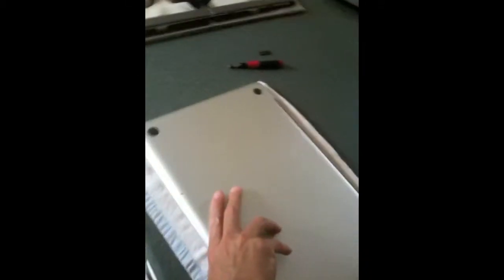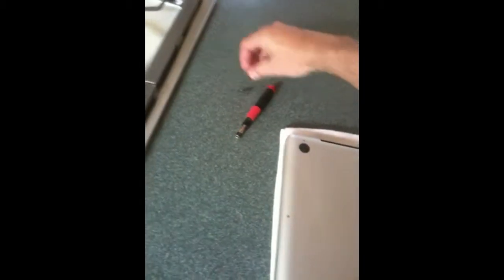When you decide to open up your MacBook, it has a pretty silver aluminum coating. It does scratch, it does ding, it does get dirty. So do yourself a favor and put it on a towel. There are very small screws around the whole perimeter of the MacBook Pro. This is the unibody MacBook Pro, so there's no door — this is the way you have to get at everything inside, even the battery.